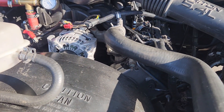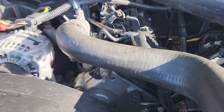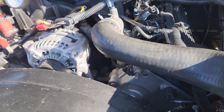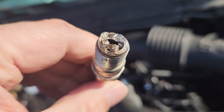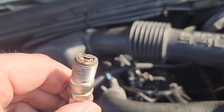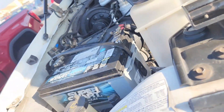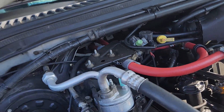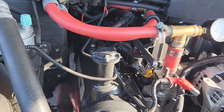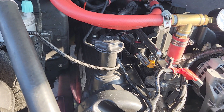This is the end of this engine. After all that work that I put into it, of all things to fail — the front left piston, number 5, disintegrated. You can see the remains of the spark plug that was in number 5. At this point, there's really no point in researching the engine catastrophe any further because it's beyond fixing at this location. The piston is disintegrated. All that's left is the rod and wrist pin, and those have been slapping against the cylinder wall. The cylinder walls are cracked and parts of it broken out.